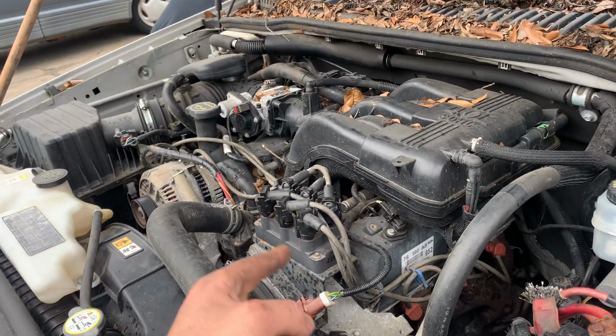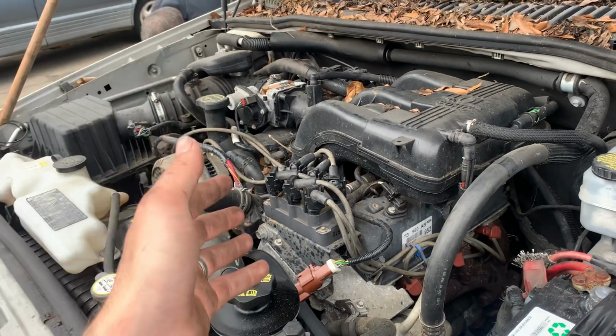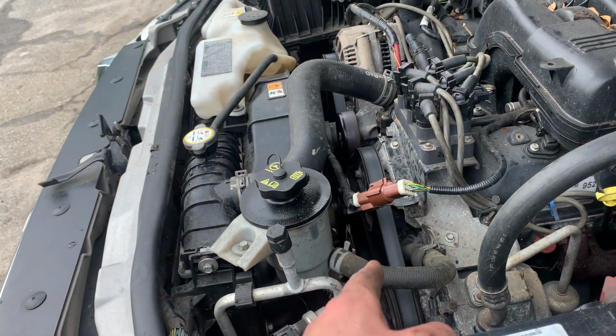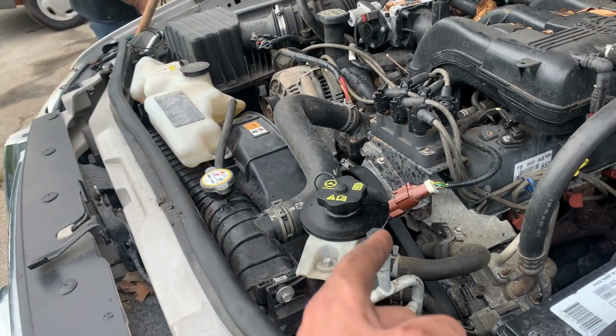Pulled a coil pack that we had as a spare from, well, we've done a million of these motors. So pulled a spare coil pack out, threw it on there, still wouldn't spark. That moves to the crank sensor. The crank sensor down there was just beaten all to death thanks to the harmonic balancer.